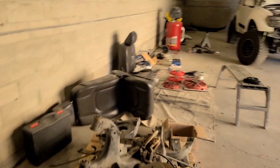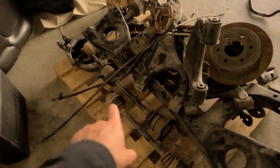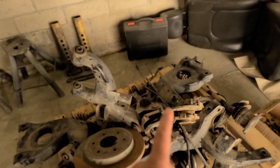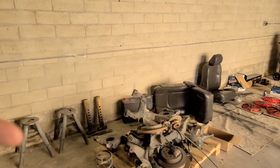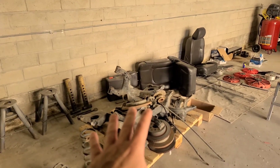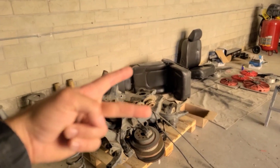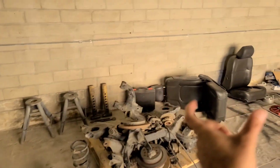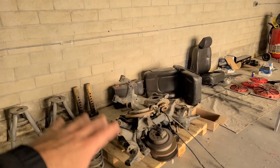Quick update for the rear armada swap. Basically all the things I changed were: armada axles, armada subframe crossmember, wheel hubs — but if you change your wheel hub you need to change the whole wheel assembly from your pathfinder to the armada. So I changed my wheel hub, and had to change rotors from the armada, calipers, brake pads, e-brake shoes, armada sway bar and sway bar links. Those are all the things I changed, so pretty much I went full armada swap.